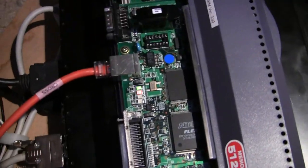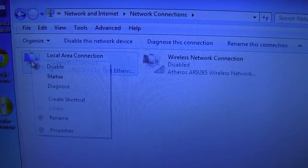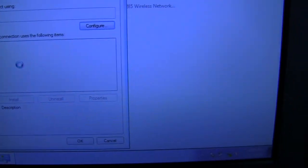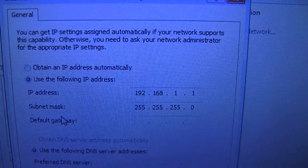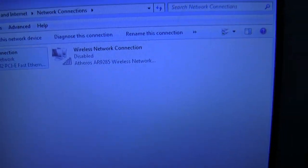This is using a crossover cable. You can go into a regular internet router or you can do a crossover cable directly into a PC, which is what I've done here. If you do that, you just have to set up your adapter on the PC — it's real simple, you can do this in a few minutes. Just go to your LAN adapter, open the properties, go to IPv4 settings, and set up your IP address: 192.168.1.1 with a basic subnet mask. That's it. Set it up like that and hit OK, and you should be good to talk to your Chihiro.